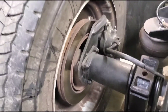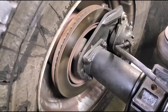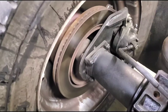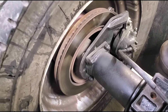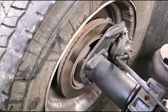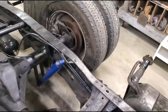I wish I had the wheels off to give you a better look, but you do have to remove the hubs and press out the studs, because the studs go through the rotors and through the hubs. I just bought Rock Auto OEM-style studs and went over to my buddy's shop that has a press. If you don't have a press, NAPA will do it for pretty cheap.